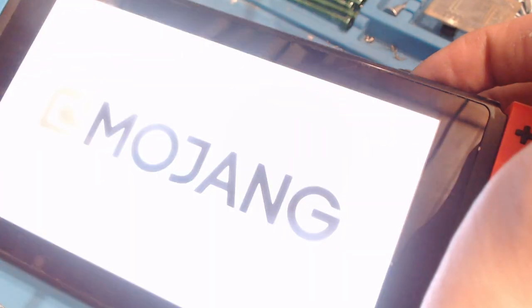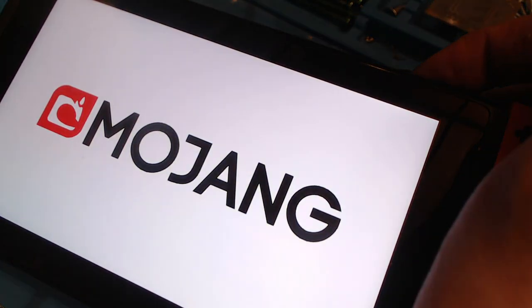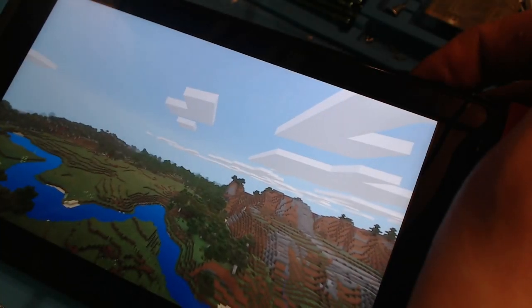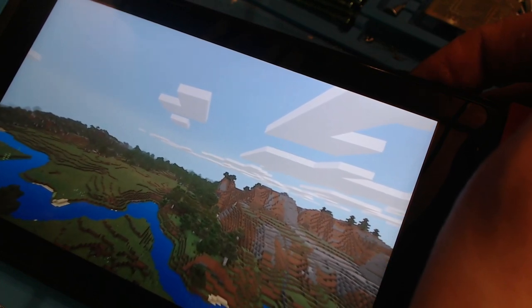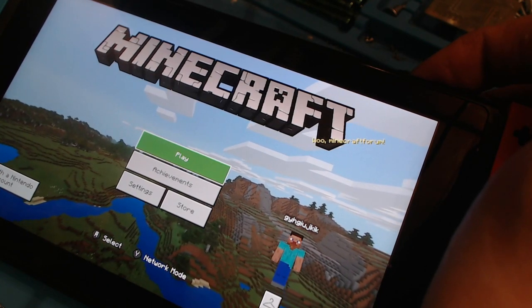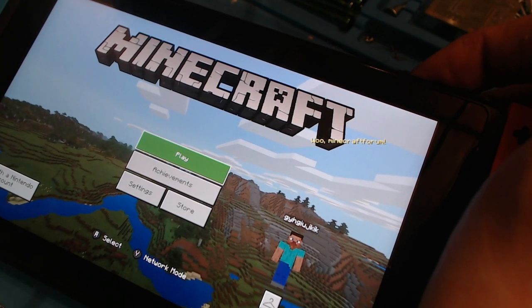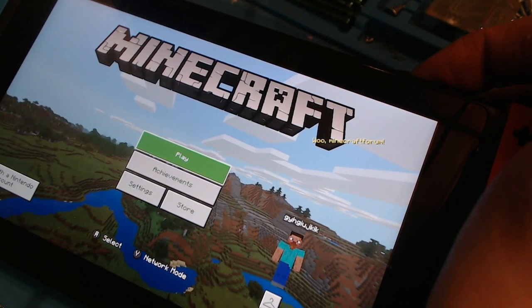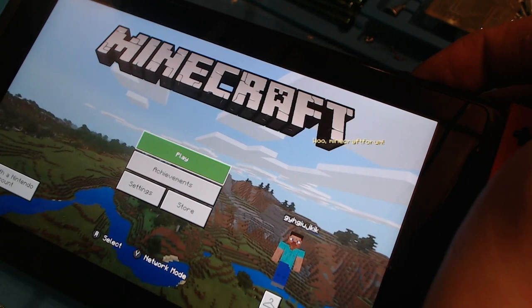I'm super happy that I managed to get this one working, especially even more so that she is a key worker. So just to summarise, this console wasn't reading cartridges because of bent pins inside the card reader. Now, these card readers are cheap enough to buy. If you've got any soldering skills at all, don't go ahead and buy the actual entire module, because you can buy just the card reader on its own. 17 pins, 6 ground legs, and you've got yourself a brand new working card reader.